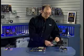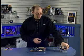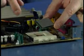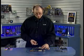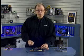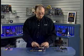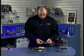Intel took a different solution to the cracking die problem, which they also experienced with the Pentium 3 — which looked similar to the AMD Athlon. What Intel did with the Pentium 4 is install what's called a heat spreader: a metal piece that completely covers the die and takes all of the force from the heat sink, spreading it across the top of the processor. This makes it impossible to crack the Pentium 4, allowing a heat sink with extremely high tension without worrying about damaging the chip.